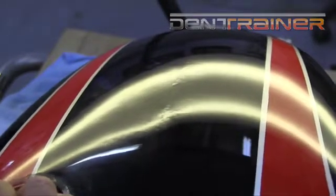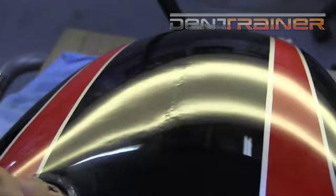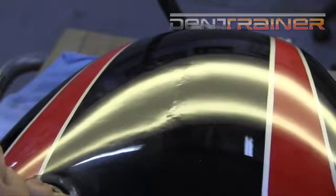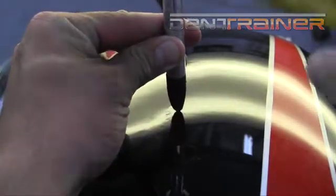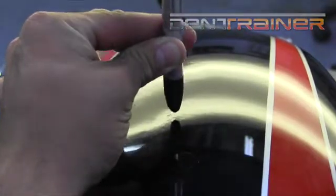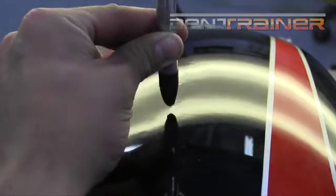I'm going to be doing some wet sanding there, just a little 2000 grit sanding in that specific location to tone down that hard line that was created in the paint. But essentially, I want it the best possible before I go to that point. So again, with your pushes, you're going to find that when you're pushing these little spots, it's going to create a big high all the way around the spot that you just pushed. So essentially, you want that big high so you can go in and control it with your knockdown.